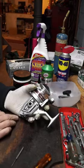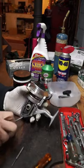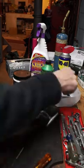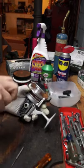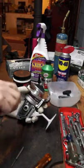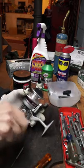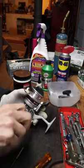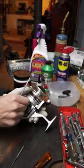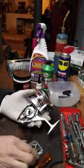The gear cover is on the drive side, and this one happens to be attached by 3 Phillips head screws. As I've mentioned in other videos, if you have a mechanical screw gun, you can use that, but in the case of this, it's only 3 screws. It's not very difficult to do. If I was doing these in mass and my arms were tired, I would go ahead and do that. So those 3 screws are taken aside. That brings the side plate off.